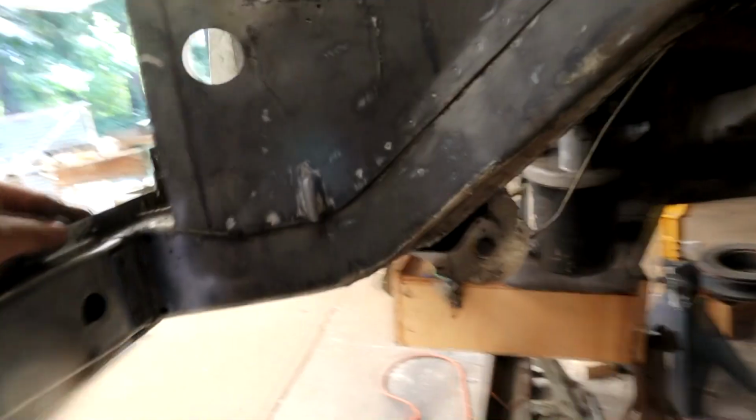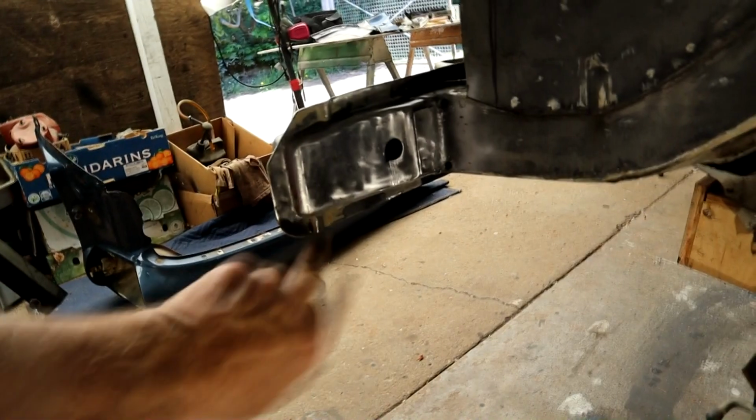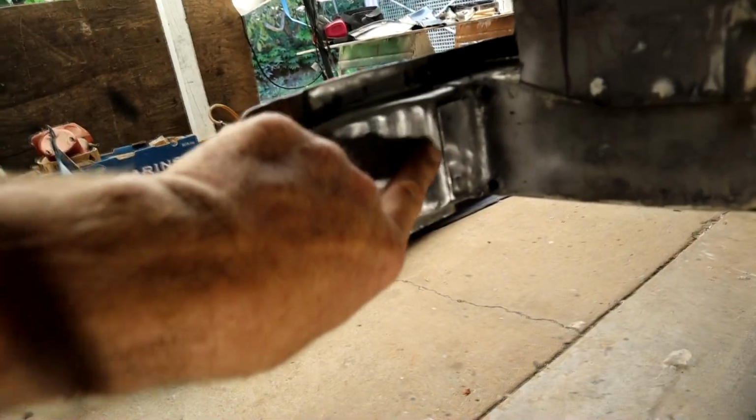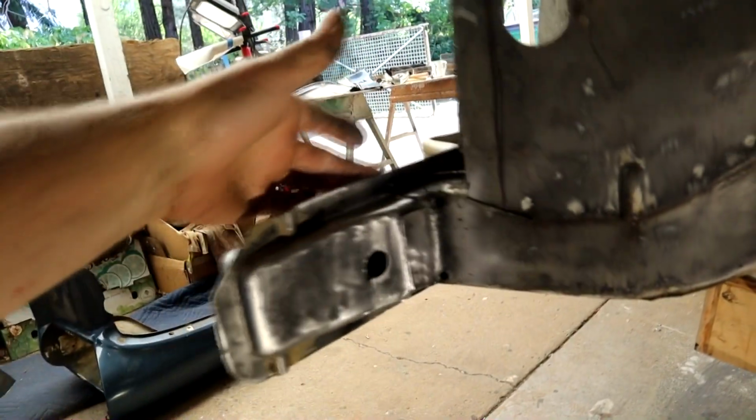So in the week I've repaired this bumper bracket here. I took this completely off the other car. Okay, that's better light here. Now this whole section is straight off of the other car. There is a weld line here. I don't know whether you can see it at all. It's gone in really nice, and I spot welded it all along, so that's completely new and fresh.